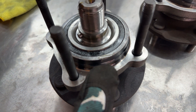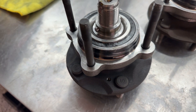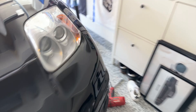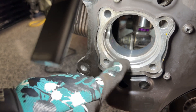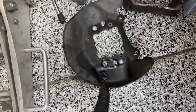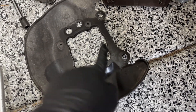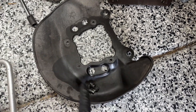You can see here there's a little pool of oil right there. There was a lot of oil and I think that's just the grease inside the bearings liquefying. There was a lot of oil built up on my hub — this is where the wheel bearing goes, it's pretty oily down there. I took the car apart a few days ago and cleaned it up and there was a bunch of oil just pooled right here. This is the dust shield that was on the leaky side, and you can see all this area covered in oil from the wheel bearing. It was leaking quite a bit.